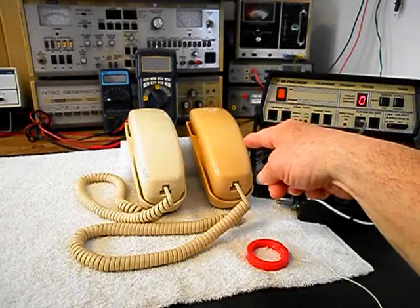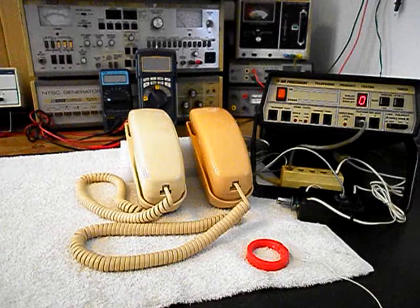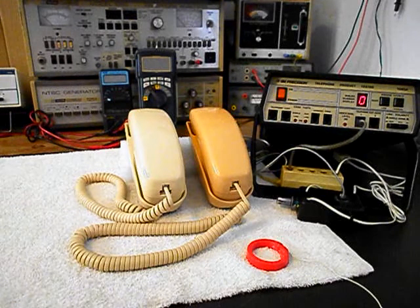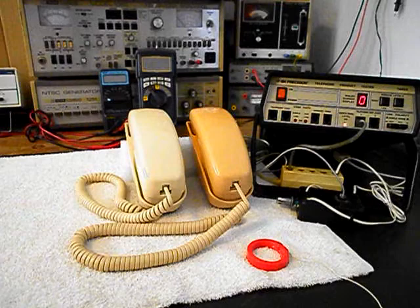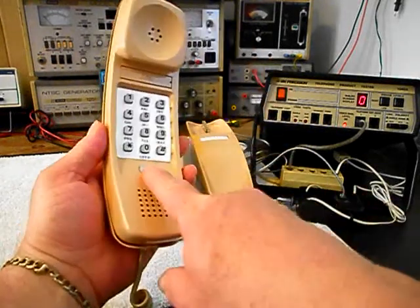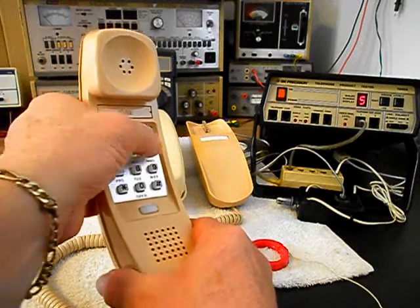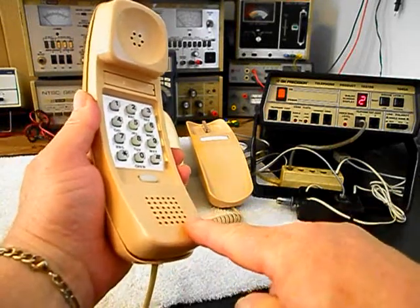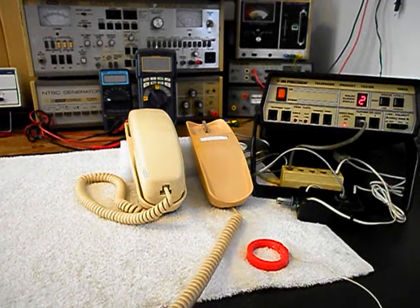We're back now and we're ready to test the second unit. We're going to send a ring cycle like you were getting a call, so we'll start that. We'll let that go a few times and we'll give you some dial tone. We want to walk through our numbers — if you watch the analyzer, you'll watch the numbers roll by. I'm going to end in a two. Now I want to transmit into the handset. If you watch that red light, every time you see that red light light up, that's an indication of 100% modulation on transmit.